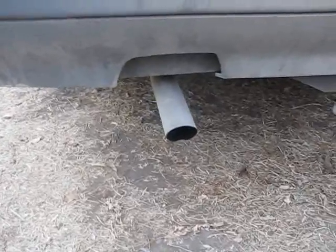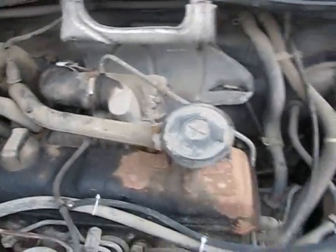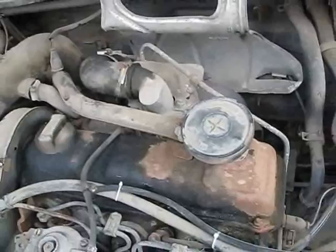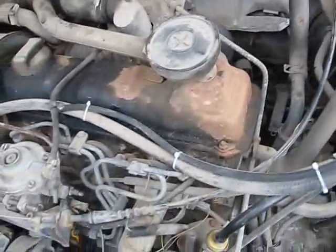I think if it's soot it's okay, but if it's a haze it means it's burning too hot. One thing I need to get for this car is a pyrometer - an exhaust gas temperature meter - because with the mods I'm doing it's kind of risky. You could easily jump up the exhaust temperature. I think these things will handle up to 1,600 degrees Fahrenheit before they start to melt stuff internally.